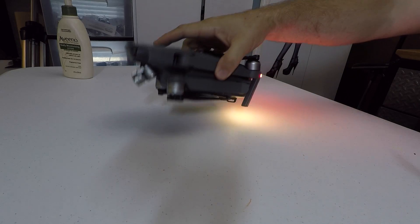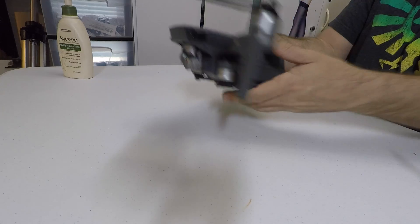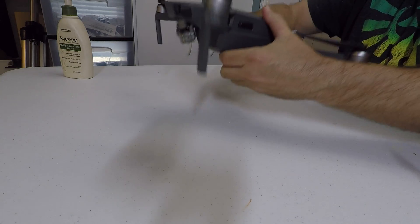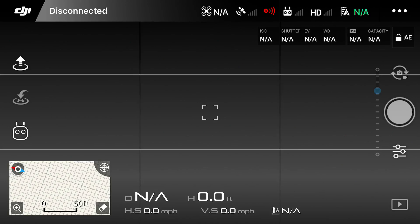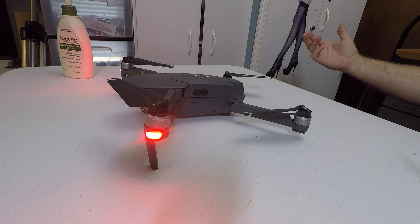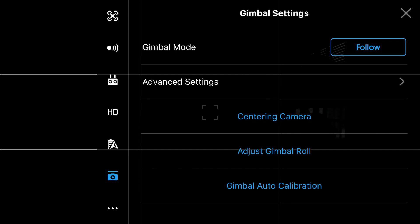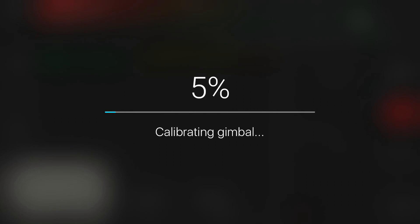So what I want to do now is turn off my aircraft. I'm going to open it up completely and redo the camera while I'm on this nice level table. Turn everything back on — and there are the dots, it never fails. When you have everything back on, go under gimbal settings and click 'Gimbal Auto Calibration.' It shows you some tips; follow those, say OK, and just wait.